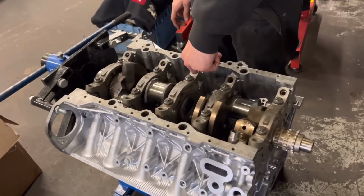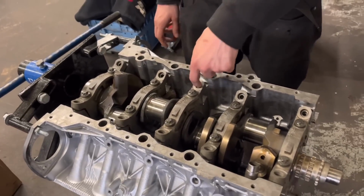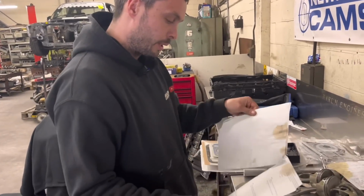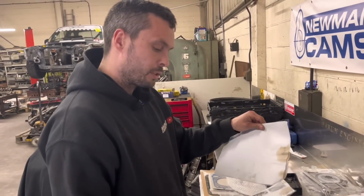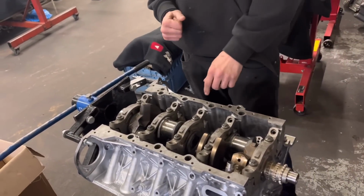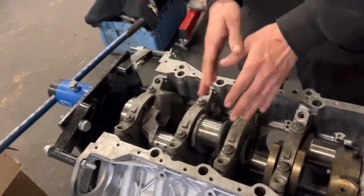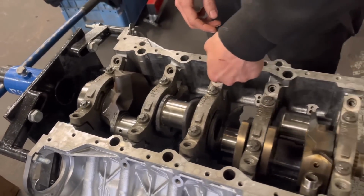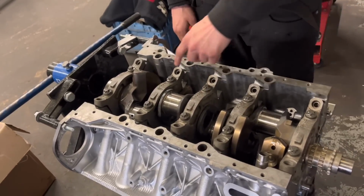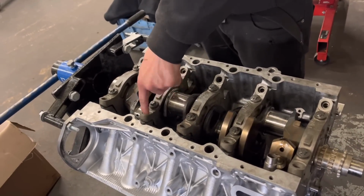And these obviously, they call them in the manual, what is the correct term? Thread support bushings. Nice. So we're putting new ones of them in, and I'm fairly certain what you do is bolt everything down and then you screw these in just to a seat basically. Yeah. So you touch the block. So when you torque these up, you've got to make sure these are wound in.